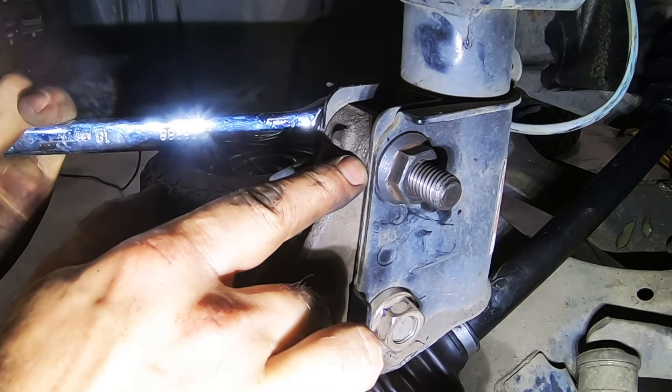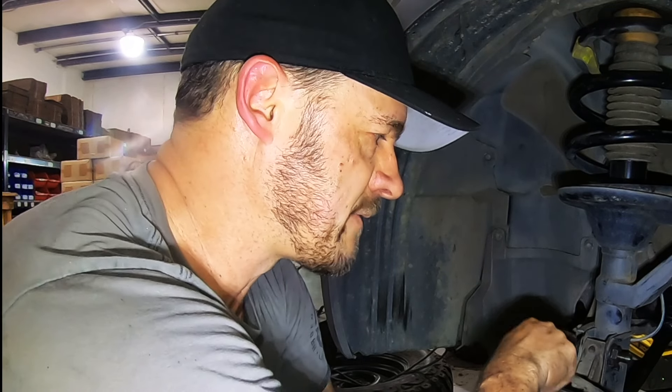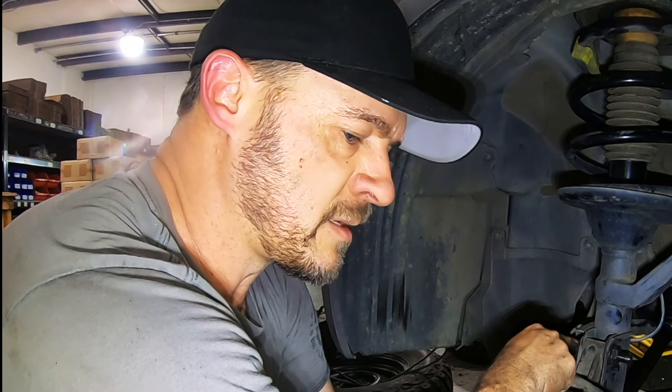It's not a lot, but it's just enough to get this dialed in for your camber. When you take your car to get an alignment done, make sure you tell your alignment tech that you have these camber bolts. I've had people get their car aligned and the camber was the same before and after — the alignment tech just didn't know they had these. From the factory you can't adjust camber, so if they didn't know the bolts were there they wouldn't even try. Make sure you tell your alignment technician that you have camber adjusters installed.